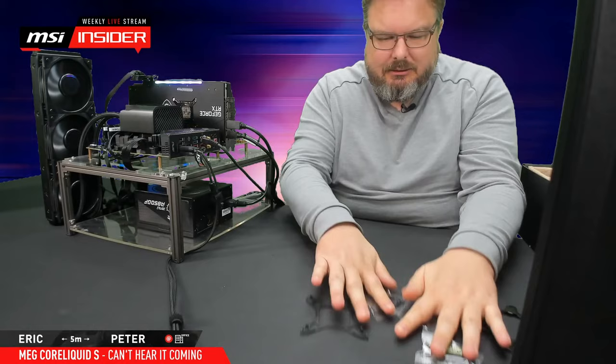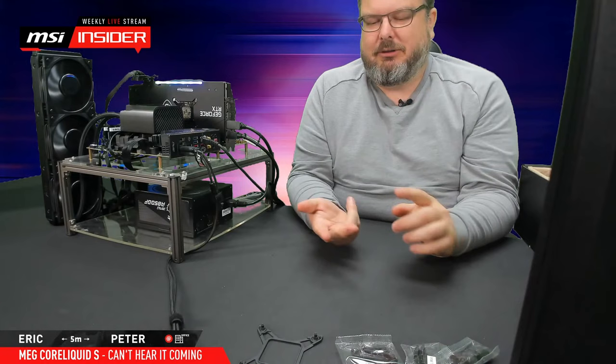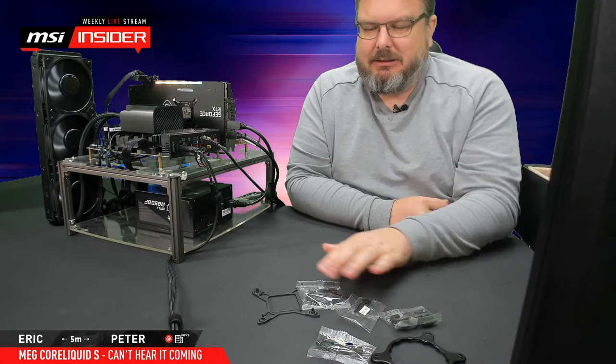In this box there are also screws for the 1100 and 1200 series from Intel, and for the 1700 series — they're slightly different. It's labeled on the package but you need to pay a little attention. There's another package with all the screws to connect the fans and to screw the radiator into the case. It's better to keep all the unused brackets and screws, because if in the future you switch platform it's always good to have options.